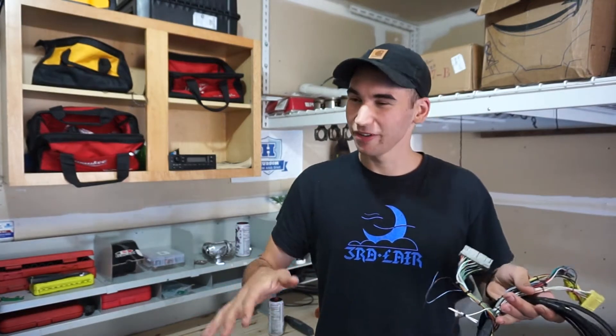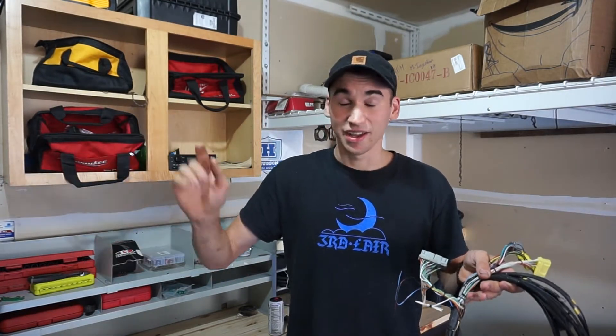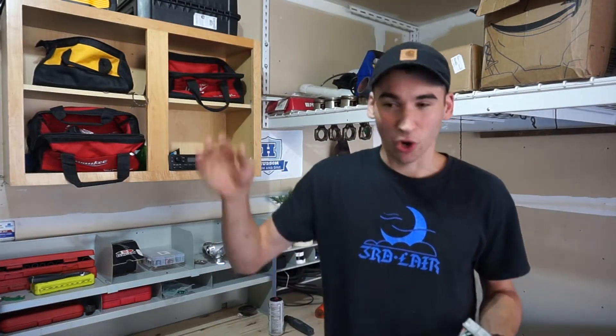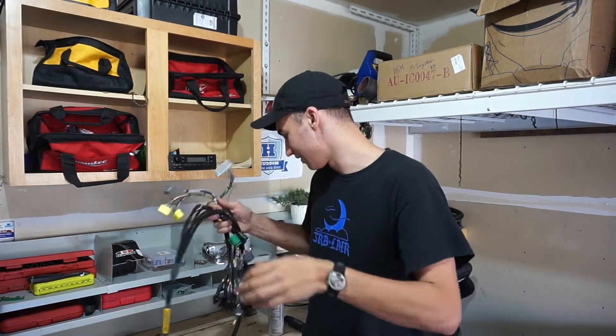So this tutorial will be a little bit different. But if you have an OBD2A — I think it's like any Civic from 1996 to 1998 — you're in luck, because installing this harness is basically plug and play. For the OBD2B or other OBD1 vehicles, you got to splice a couple wires. But we're going to do our best to get this installed today.